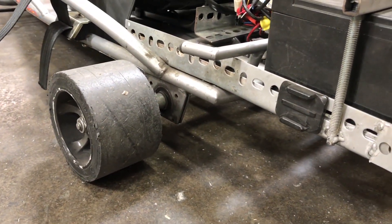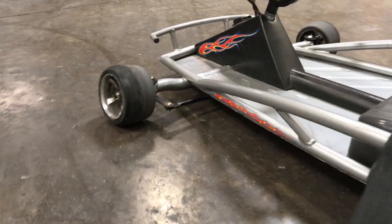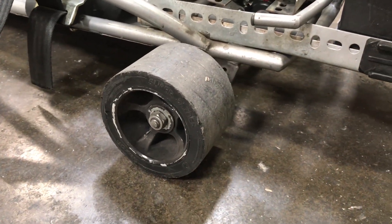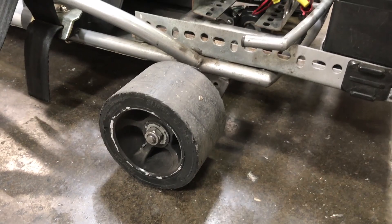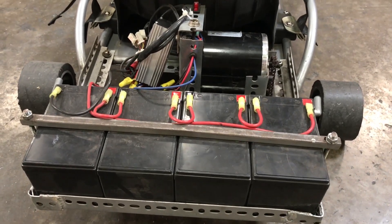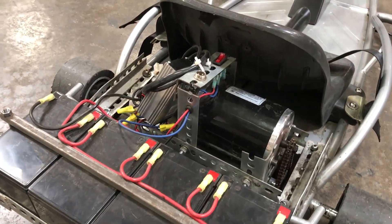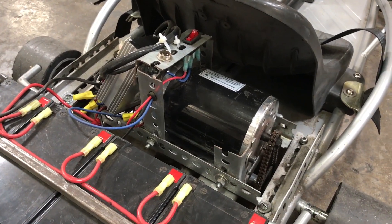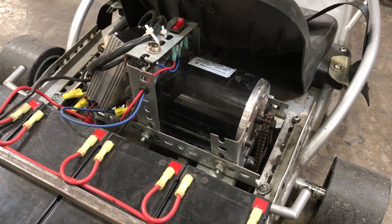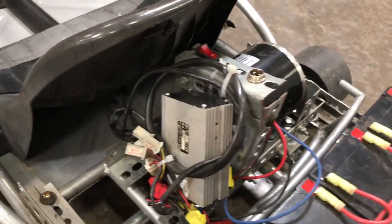In order to do that, you can't put the Ground Force front tires on the back on the new axle from the drifter — they don't have room for the bearing setup, so it doesn't work. So we simply upgraded the tires, which is more fun anyway because it gives us drifting, which we hadn't thought of doing before. The drifting with the bigger tires, better axle, and heavier riders causes more amp draw from the motor to get moving, and once that starts happening, it's pulling more voltage and amps through the controller.